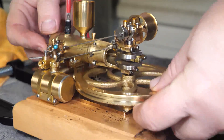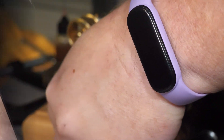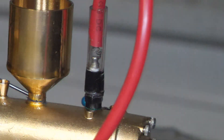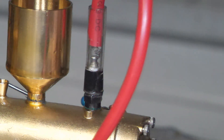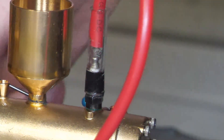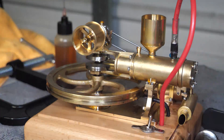The R18 was running rough again and of course it's hot — it ran for 20 minutes. Yep, you can see it arcing on the outside of the plug again.